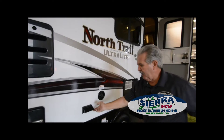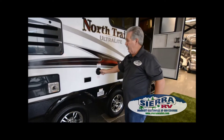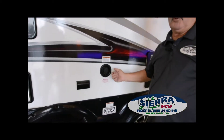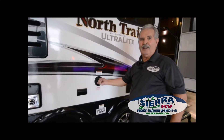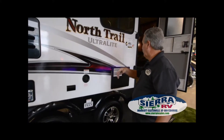There are a couple of outside plugs right here. To fill the water tank, it's right here. When you fill these water tanks, you always want to fill them kind of slow. People try to fill them fast and the water starts spurting out so they think it's full, but then they get to camp and they only have half a tank. So make sure you check the levels before you leave — I'll show you where those are.